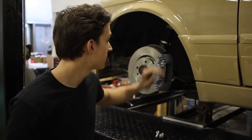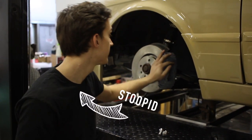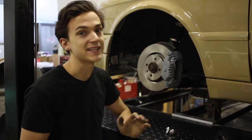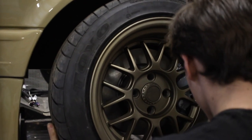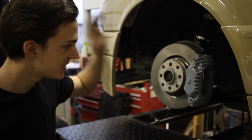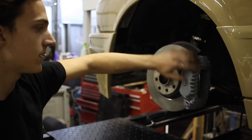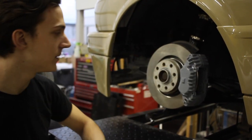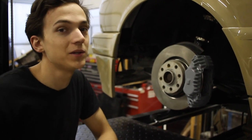The wheel is hitting the caliper right now. When we tested for clearance, we had the bracket mounted incorrectly. So we're going to mount the wheel with a 15mm spacer and see if we can fix that. We definitely need to use the wheel spacer, but on top of that, these ribs here are rubbing a little bit on the wheel. I'm hoping we can just grind them down so the wheel will fit and I can run these, because I really want to use them.